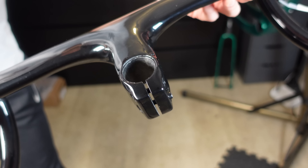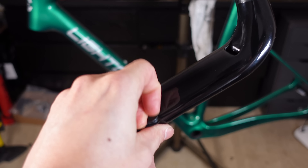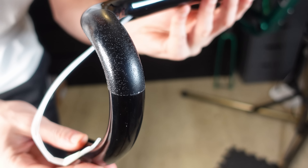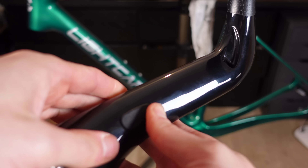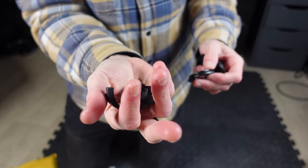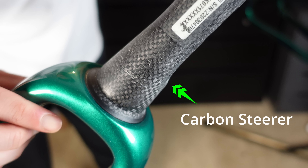The handlebars are fully integrated and they work nicely with the frame. We have rubber grommets in the bars which can be removed, giving you two ways to route the cables — a nice touch. We also have a rough section in place for the shifters to get a better grip. Sizing-wise, you can order any combination of 40, 42, or 44 centimetres for the width and 90, 100, 110, or 120 for the stem. It's also nice to see that the headset spacers can be split into two halves, making it easier to add or remove them once routed cables are in place. They are plastic and not aluminium — the plastic won't damage your carbon steerer tube if anything wears or rubs.